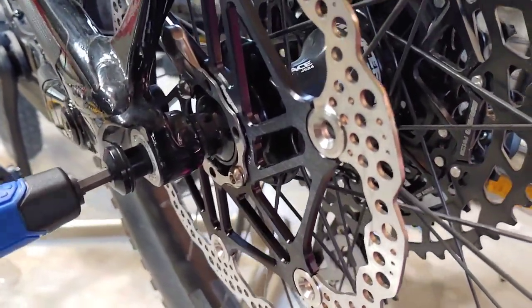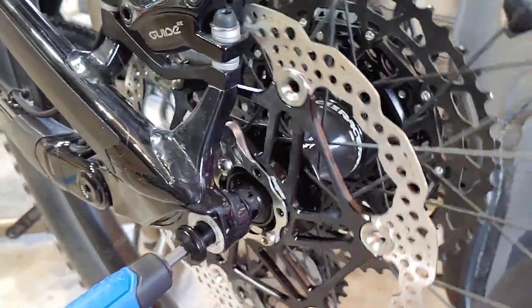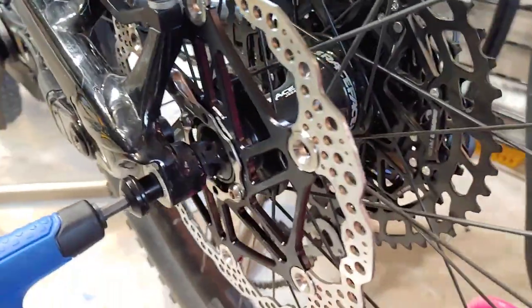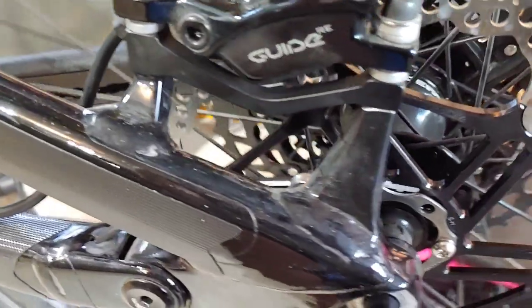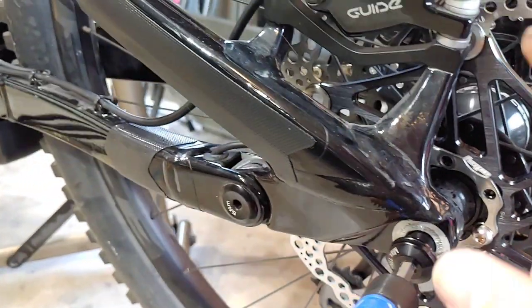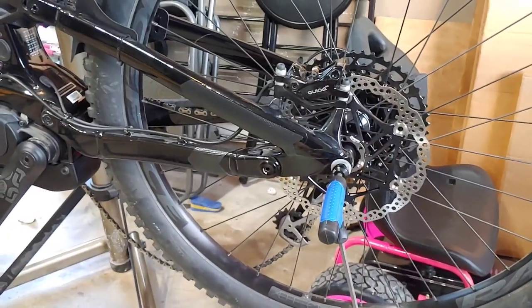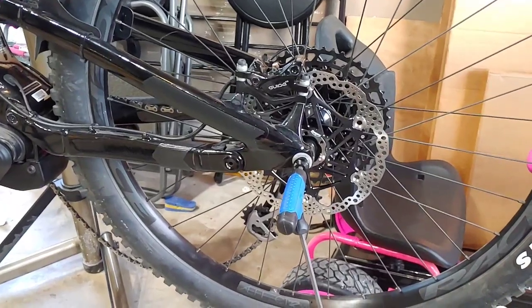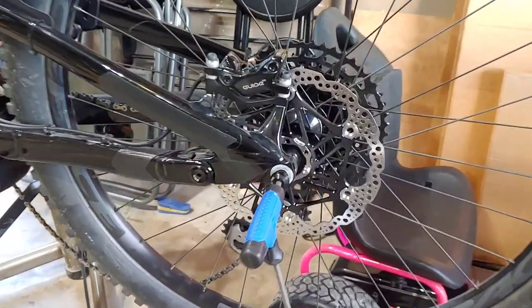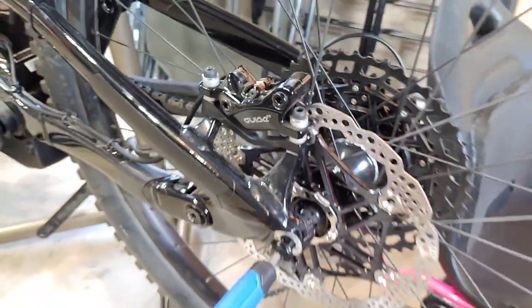I don't think I'll need to shave the bolts down, I think I'll just need to shave that part down. That back one's going to rub slightly if I don't — it'll slowly start to eat away at the caliper mount. So I'll probably just grab a Dremel and shave that down just a hair. This is all aluminum so I don't think we'll have any problems. Part of me is thinking maybe we'll just put the standard rotor on the back and keep the other one up front. That is so close.